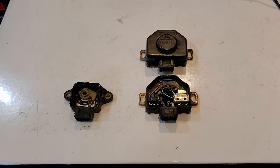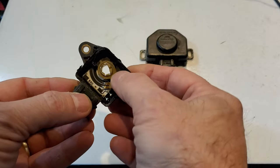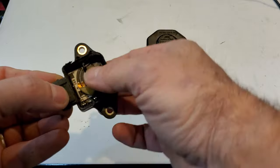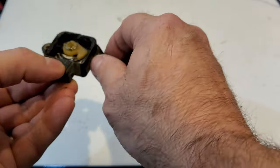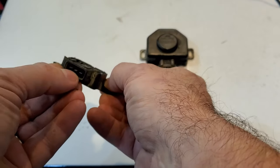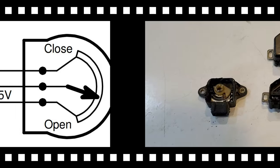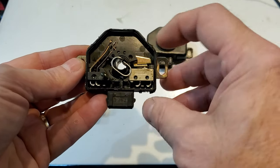These are the standard two switches we have — your 2.4 Motronic, and I believe some of these might come in a later LE2 injection but not an Opel. You'll see that this has a sweeping track with two connectors that go to these pins. It feeds a voltage in here and reads the difference in voltage based upon the power going from one pin to the other. This is your standard one you see on most L-Jet.